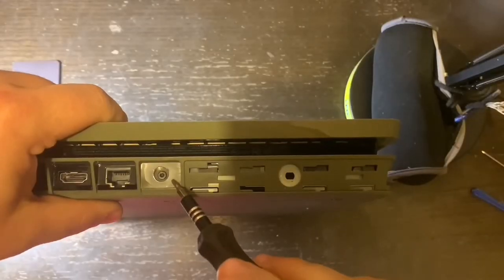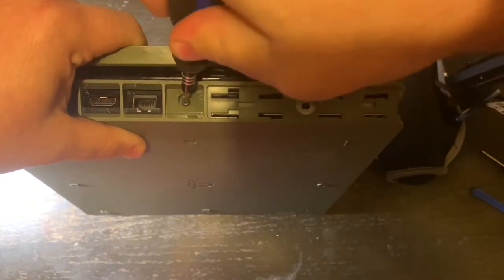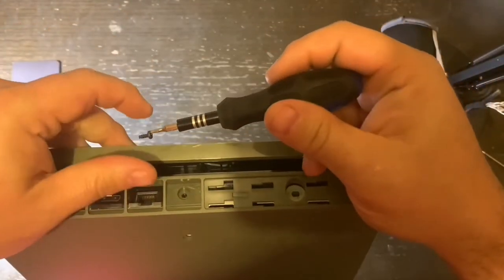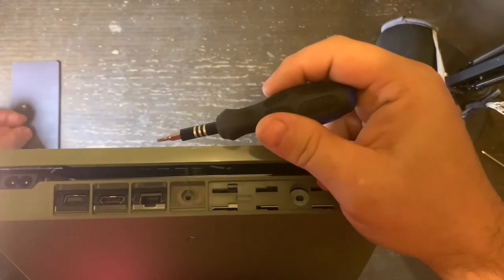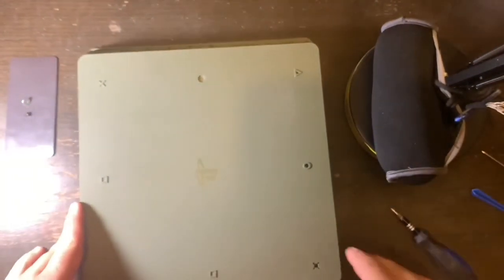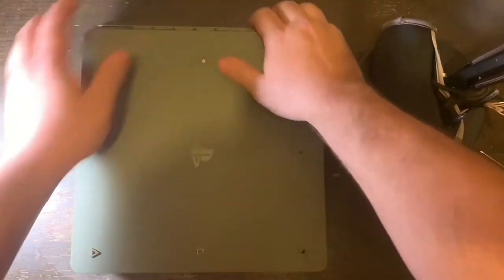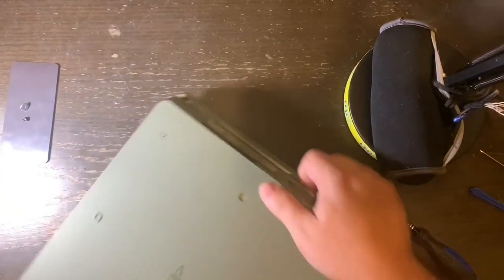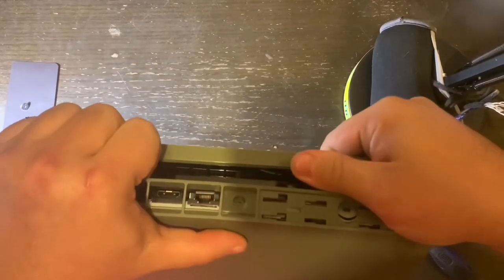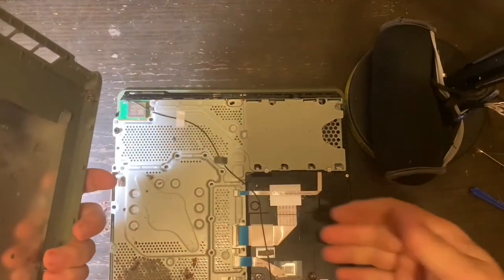You are ready to take the main screw out. This is a Torx 8 screw that is holding on the chassis — by chassis I mean the black plastic coverings of the PlayStation 4 itself. This is a PlayStation Slim, guys, in case you haven't already noticed. Start by pulling from the back gently once that screw is out. Just grab a hold of it, pull up and back — make sure you're facing backwards where all the ports are. Don't do it too hard but give it a firm pull, and it just pulls right off.